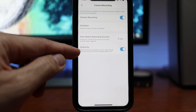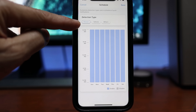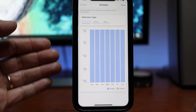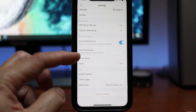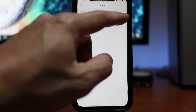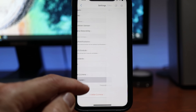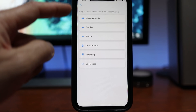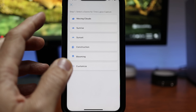We have overwrite on or off. Then push notifications, toggle on or off. We also have push schedule where you can schedule and customize which alerts you want to get — only person and/or vehicle or all events — and schedule the times you want to get notified. You can set up email alerts. And we have the siren: you can turn it on if you want it to sound when the camera detects motion, or you can even record your own voice to make an announcement. Then we have a new feature: the timelapse, where you can set the camera to record a timelapse and select preset options or customize the timelapse settings.